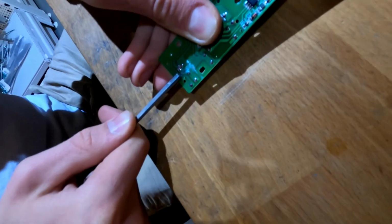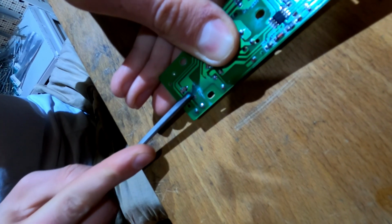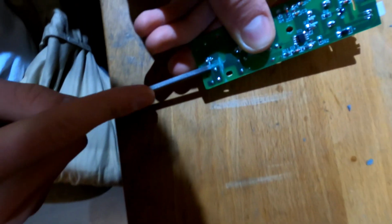For that, we had to cut through the circuit that was used when the buttons still controlled the toaster related things, but now we needed it to do something else, so we had to cut it. After that was done, it was time to solder the cables onto the circuit.